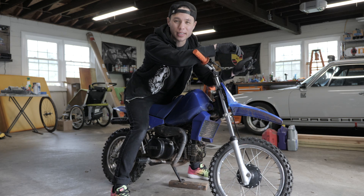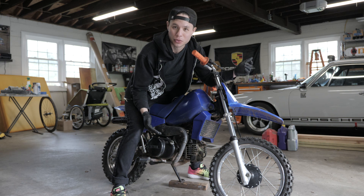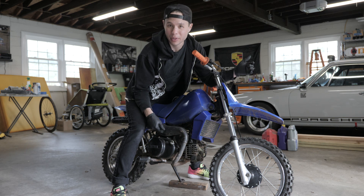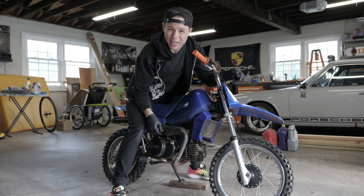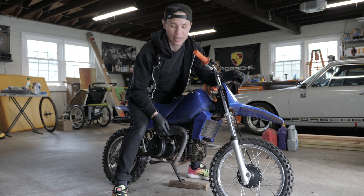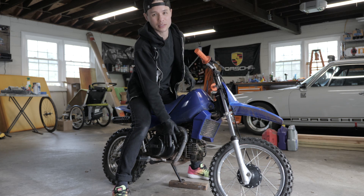That's pretty much all there is to it. Again, just the real quick nitty-gritty, quick clean out, get back to riding kind of rebuild here. If you want to see a more in-depth carburetor service or rebuild, post it in the comments — maybe we'll do one of those as well. Otherwise, just do that, clean out the jet, and then go ride again. Now that we're cleaned out, let's see how many kicks this thing takes to fire up — this is completely cold, let's see how we do.